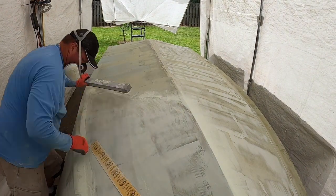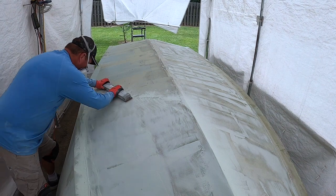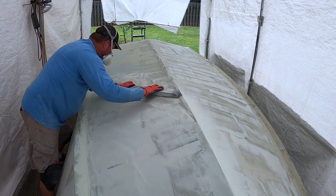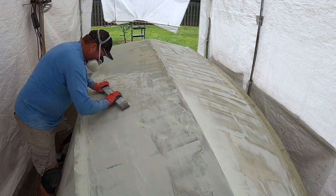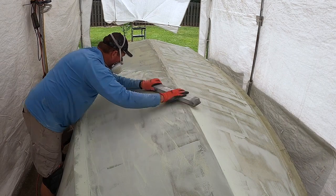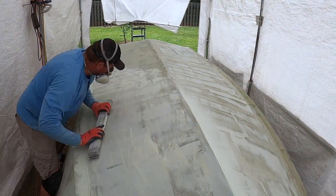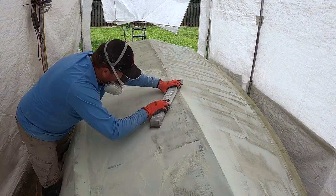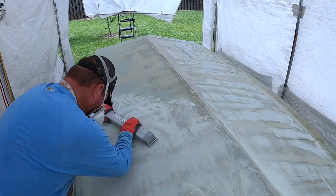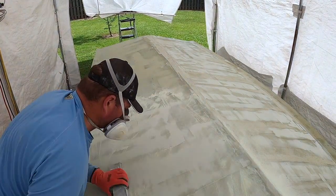You're going to see right here, that paper come off. Once again, a while back I tried to just take the paper off and put a new piece on, but that fairing dust is so fine that it gets on the surface and won't let the paper stick. So what I do each time I pull the sandpaper off, it's an adhesive-backed Dura Gold or something like that brand, I think I've described that before.